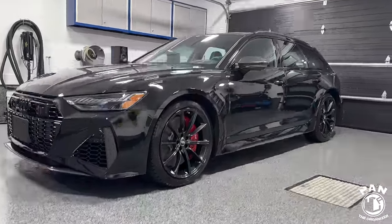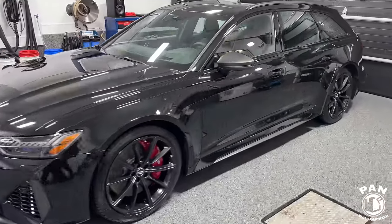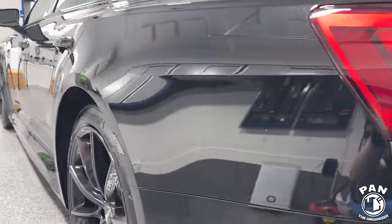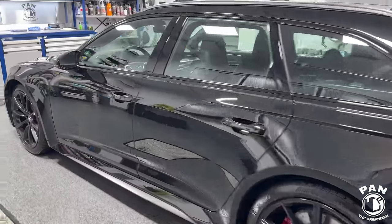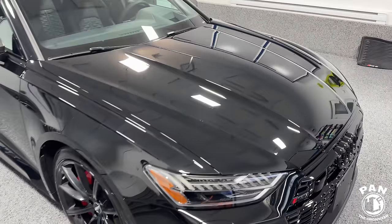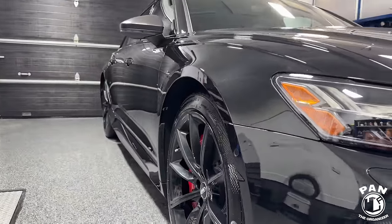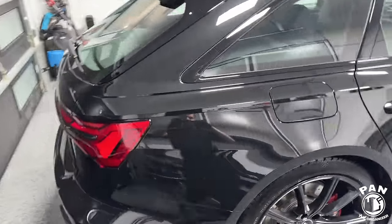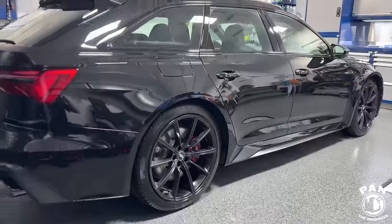Let's have a look at the final results. The coating has a one-hour curing time — after an hour you can drive it in the rain, but ideally let it sit for eight hours. I was able to leave it overnight in my garage, and I'd recommend waiting two weeks before washing the car again. It's like a mirror — dripping wet, super glossy, very slick. The three-year coating focuses on slickness and water spot resistance, the five-year is for gloss, and the eight-year is for gloss, slickness, and ultimate durability.